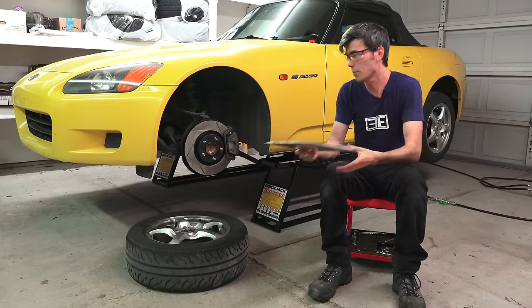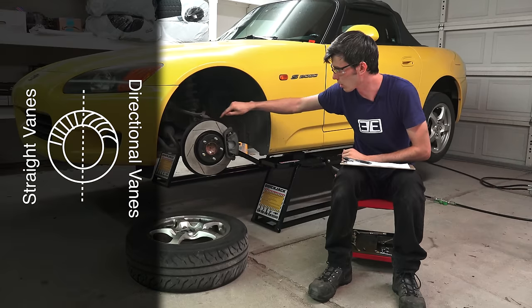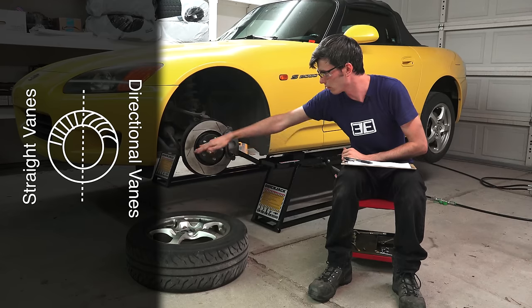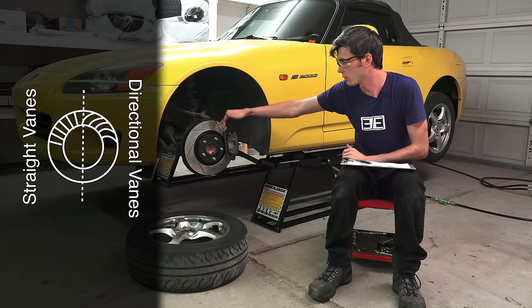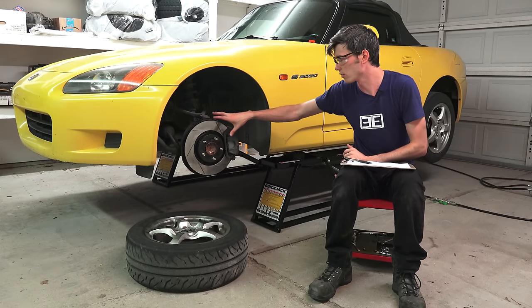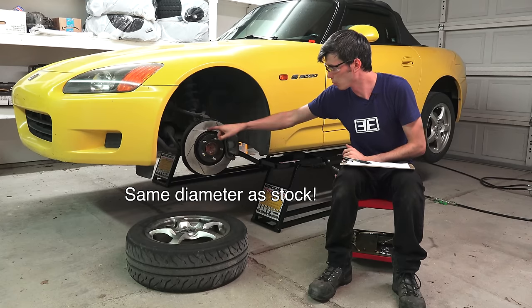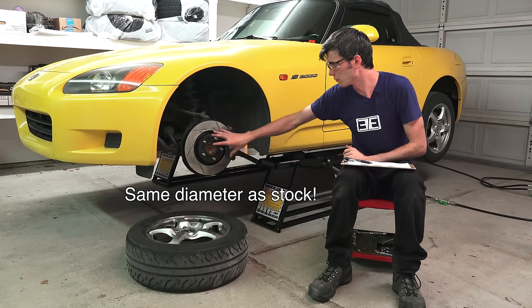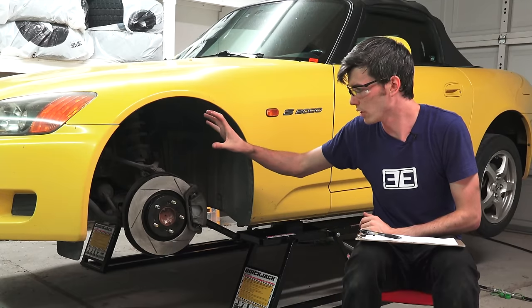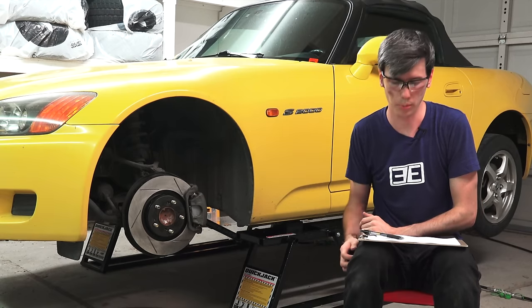Let's talk about directional rotors. What is a directional rotor? Basically you have vanes in here which are curved, so they try to rotate and spin the air out, rather than just straight vanes which you'll have on stock vehicles. These are going to be directional — you can only put this rotor on the left side, the other rotor on the right side. Some people think this is on the wrong side because of the slots, but in fact this is the correct side based on how the vanes are oriented.